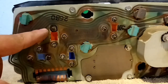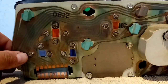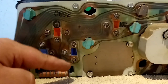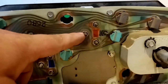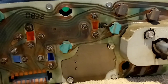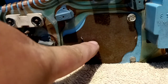When you go over to the optional cluster, you have three individual gauges in this big round dome, and that's how you replace each one. Your connectors are here, and this one is your gas hand — so it's quite different on the optional versus the standard gauge cluster. The empty plate is here and it's identical to the empty plate on the standard one.